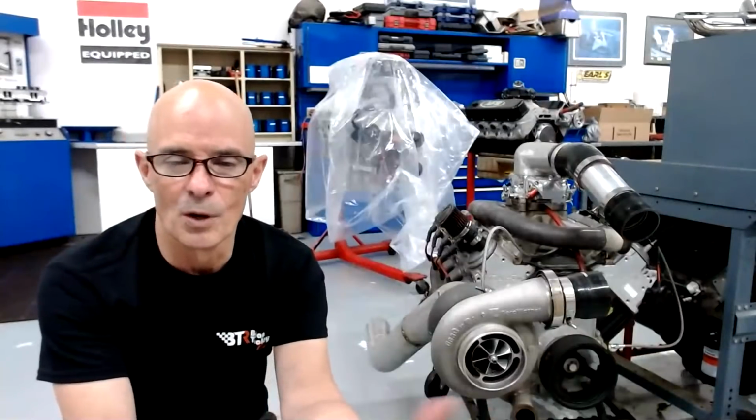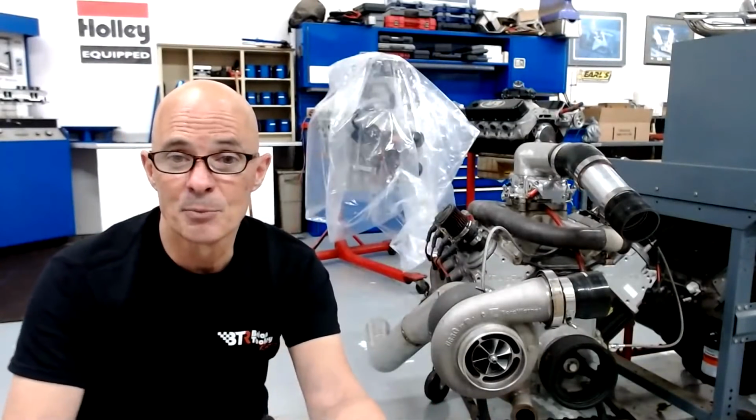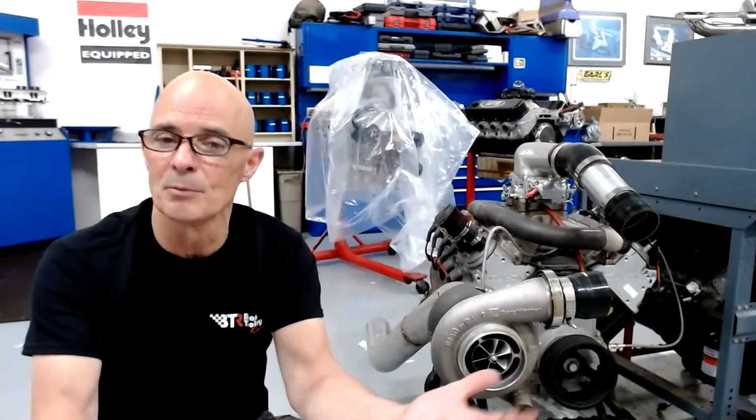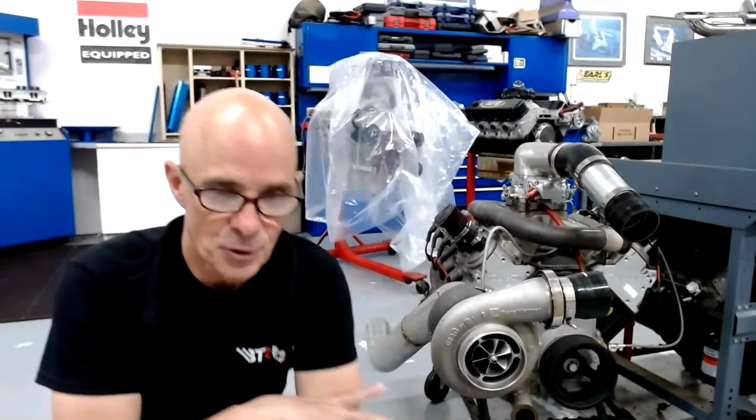Tipsy, the thing is, there's a big difference, and I don't know what kind of forced induction you're running. On my Mustang, we ran a Vortech. So when you'd roll into it, there'd only be 1 or 2 pounds, and it didn't have peak boost until the end of the RPM range, 6,000 let's say. That creates a lot less torque and is a lot more forgiving on the street. I even ran it with 87 octane, and I could drive around and not go into boost. Most people can't do that. So a centrifugal is going to be much more user-friendly on pump gas than a turbo, because a turbo, when it comes on, is going to have another 100 or 150 foot-pounds of torque compared to a centrifugal. So it's going to be a much different animal.